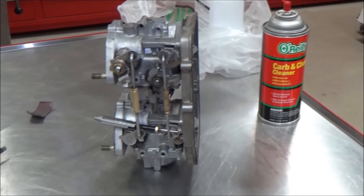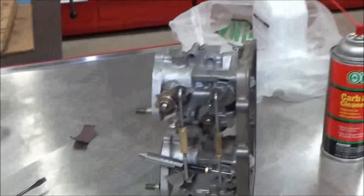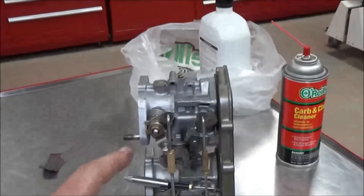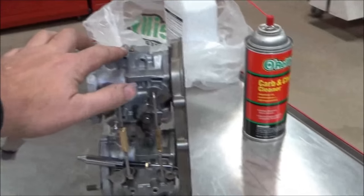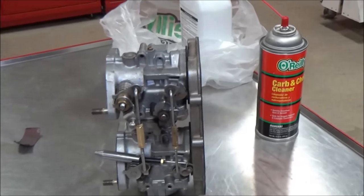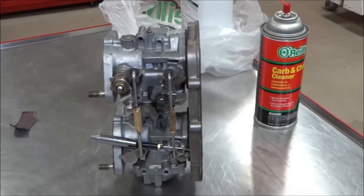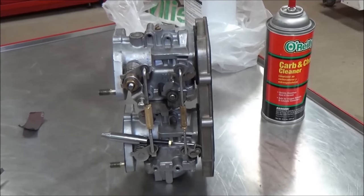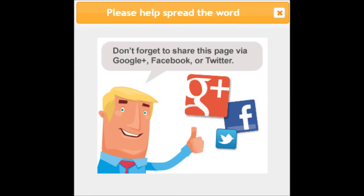Also keep in mind that when I took this apart, one big clue that something was off was that those screws were barely open. These have really large pilot jets, so to have the air shut nearly all the way off is another reason my plugs were burning pretty rich when trolling. Always look for clues, put the evidence together, and keep on wrenching.